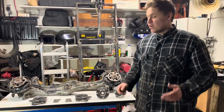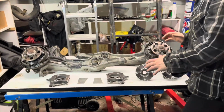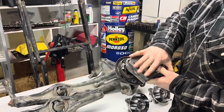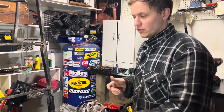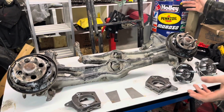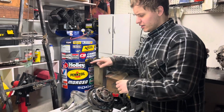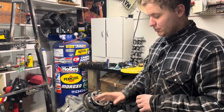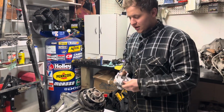On today's episode, we're going to be doing some del sol prep. So Aiden's going to be working on trailing arms. He's got some modification plates for bolting on Insight hubs, front hubs, to accept axles for the rear. So you're going to take original EG, well, in his case, del sol specifically, rear trailing arms, and you got to cut out the back, some of the front, and do some welding and some measuring to put these on, weld them in place, and then he's going to be able to put these, like I said, Insight hubs.